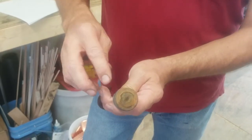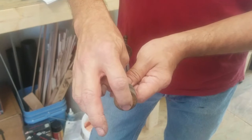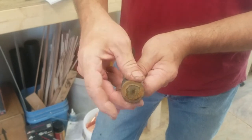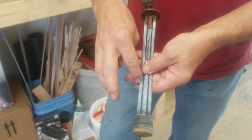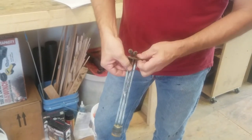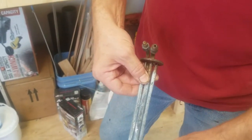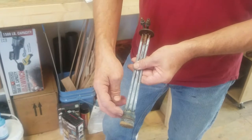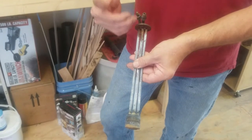It's merely fastened to the same circular plate at the top. On the bottom we have a bell that allows the fuel pickup in the center. The fuel pickup just runs down to the bottom and has a nice screen to keep junk from going in. Then you have this solid piece, which is hollow inside, that allows the other two tubes to go down into it. The tube on one side, which does not go through the top, has a vent in the top of it — right below the plate there's a little hole, and that's a vent. The opposite tube has a hole at the bottom. We use this column of air, when there's fuel in the tank, to read the pressure and tell us how much fuel is in the tank.